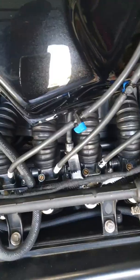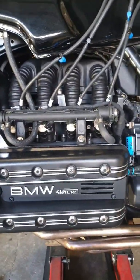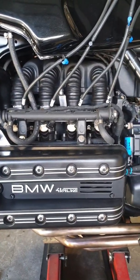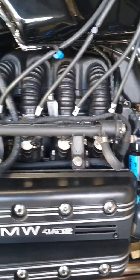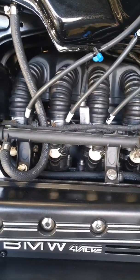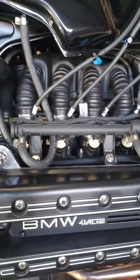In the end I've had to open them, because what I found after a bit more research is I never bench-tuned the throttle bodies. I don't know what happened before me, but when I took them out — I'll try and post pictures — TB1 and 4 had massive gaps in there, whereas 2 and 3 were virtually almost closed. I did this by shining a little head torch up into the bottom of the TBs and then just adjusted the screws — the screws that shall not be touched, but I've touched them anyway.